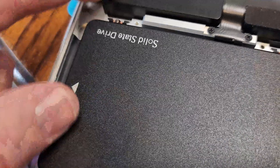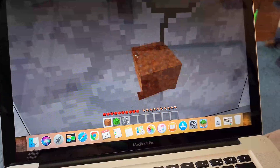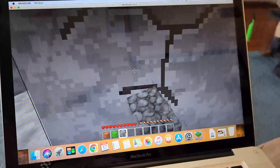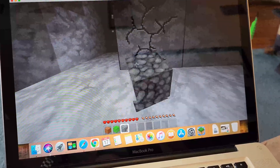Here's that dreaded moment where it won't load the OS and you think, what did I do — did I break it? No, the solid state drive just wasn't clicked in all the way. Simple mistake. So we'll pop that back in, get it screwed down properly, and the computer loads up. I tried watching YouTube and playing a little bit of Multicraft — just a weird little Minecraft knockoff — but the temperatures, unfortunately, were the same. So yeah, big waste of time, but I feel better because I got to replace thermal paste on yet another thing. Thanks for watching.